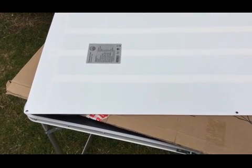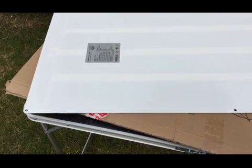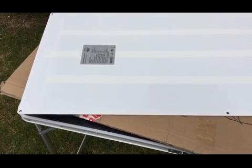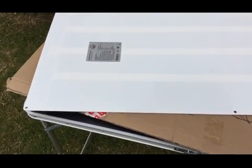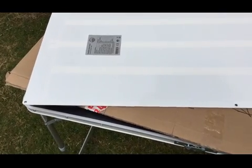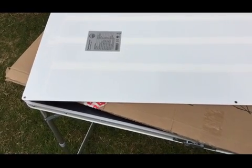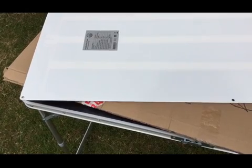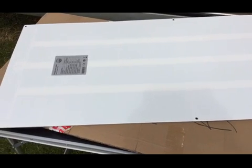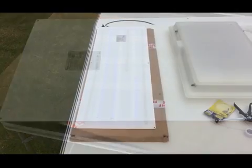And then once that's pretty much gone off, I'm going to bead it around the edge, a bit like you bead tiles in a bathroom, to make it watertight. And also there's 6 holes there, so I'm going to fill them up with some beading as well, so it's solid, watertight, no leaks, no problems, no rot underneath it. So that's that. Come back shortly once I've taped it.